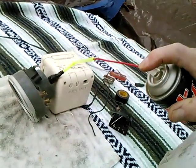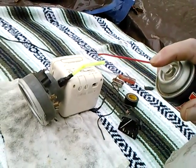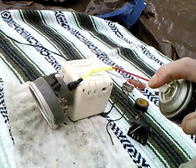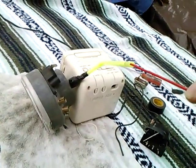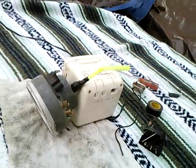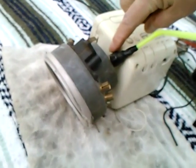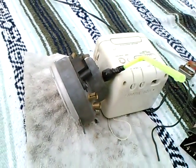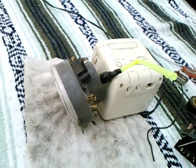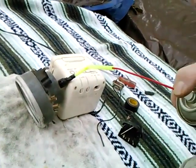I'll fill the straw with Tri-Flow. This worked like gangbusters on the speedometer I'm using in the car — I just keep the straw full and let it soak in. As you'll notice, the speedometer cable comes in at quite an angle. I presume there's some kind of a gear drive inside to straighten that out, which apparently has lost lubrication and become noisy, and in this case completely seized up in storage.